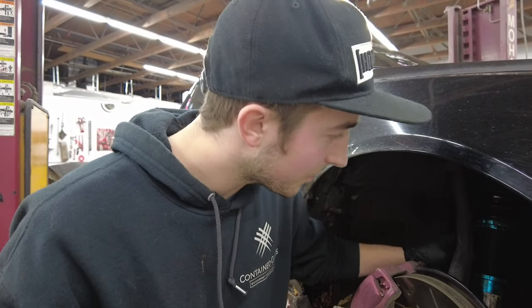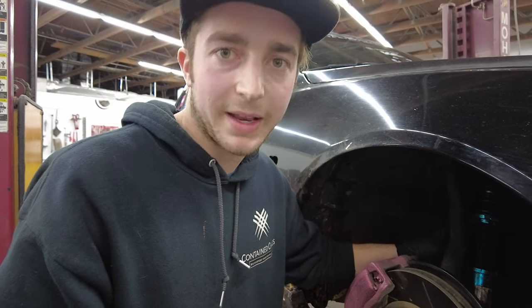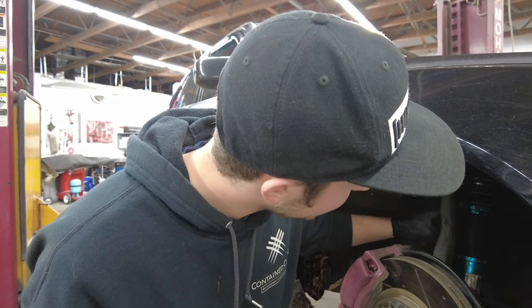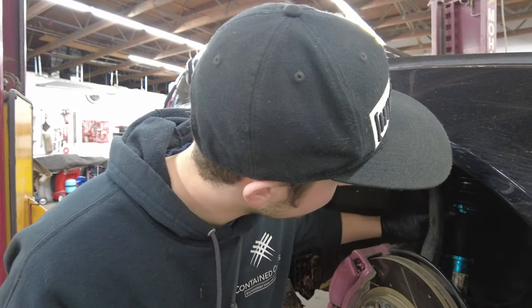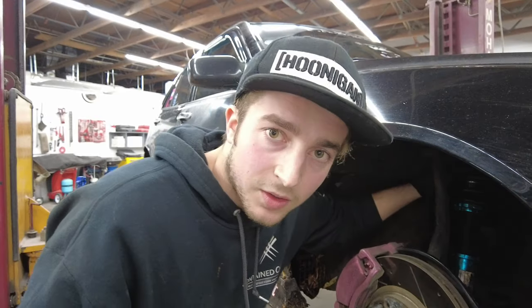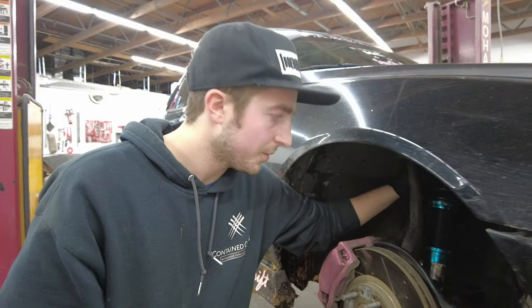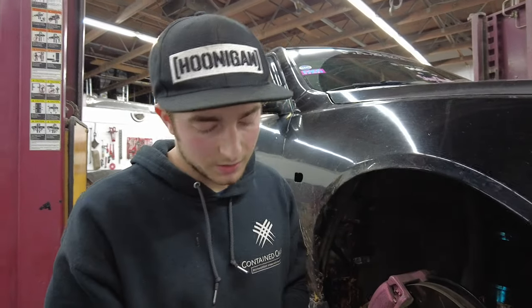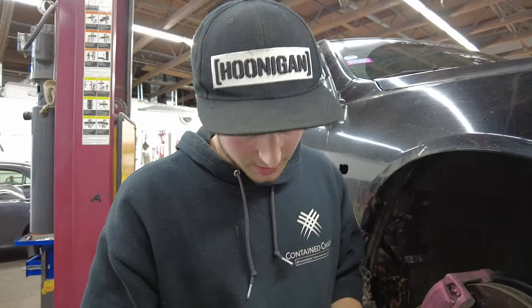We have tight coils because we drift and you get grime in there, and we tighten them pretty good. If you loosen this, not that it makes the biggest difference because you catch yourself, but you can break this collar loose and mess up the preload on the spring. And if you mess that up, it can screw with the dampening. I don't know what they design them for. People do it, but I wouldn't.